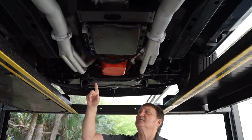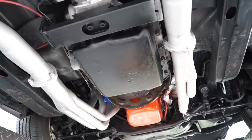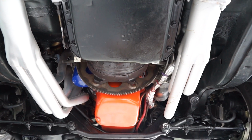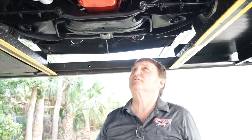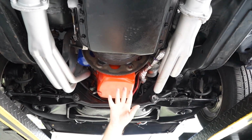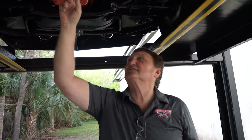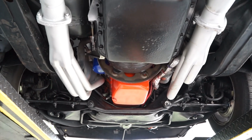Overdrive transmission? Yeah, we got one of those. It does have a converter that I'm going to call 3,000 RPM just from the way it felt driving it, but I don't know exactly. But it is definitely a smaller diameter converter. There's no cover over the bell housing of the vehicle, to allow air to get up in there and ventilate and keep that transmission fluid as cool as possible. Nice flex plate, flywheel, whatever you want to designate it, for an automatic transmission.